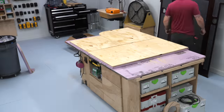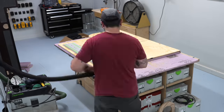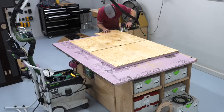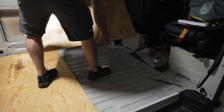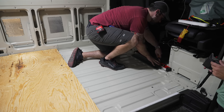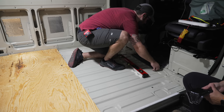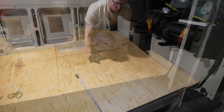Back to the floor — the second panel fit great so I could work on the last pieces. I had to get a little creative here to maximize the plywood yield, using three separate pieces for the last section. This actually ended up working out great because there was a lot more scribing and fitting in this area since the factory floor didn't extend into this area due to the partition wall. After cutting the front floor liner flush with the seats, these panels fit perfectly after fitting them one by one.